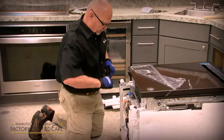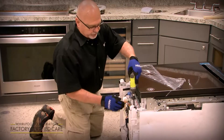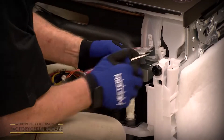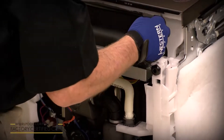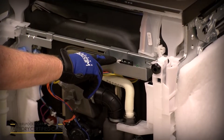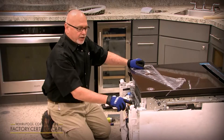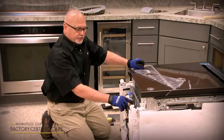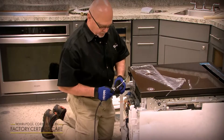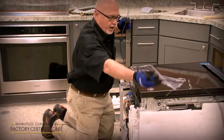Next, take the electrical junction box cover off — that's a quarter-inch or T20 screw. Once you get the screw out, lift up with a flat blade screwdriver and it comes right off. This is the new terminal box: in the past our power cord or hard wire came in here and there were three wire nuts. Now we have a terminal box where you take the screw out, put it through the eyelet, and screw it back down. We'll demonstrate using a power cord.